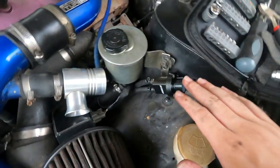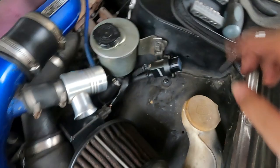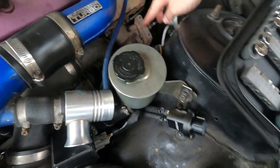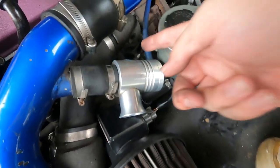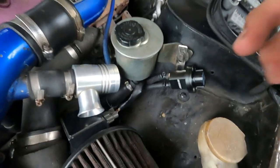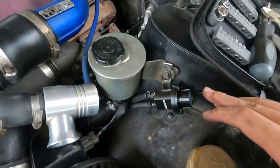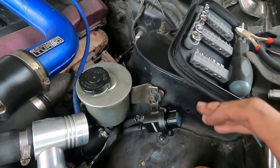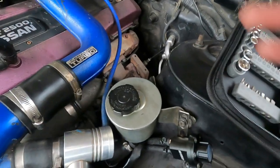This install is pretty easy. The hoses are already all installed. What I have to do is remove the old solenoid — this is the Blitz SPC — and replace it with the WORX manual boost controller. One hose comes out from the turbo and another goes into the wastegate. If you're using a standard setup, you might need to cut the hose and join it to the boost controller. Basically what this boost controller does is control the flap in the turbo — the higher the boost setting, the flap won't open as easily. That's how you increase boost in your turbo — a very layman explanation of how a boost controller works.